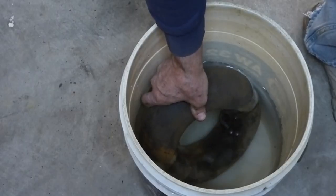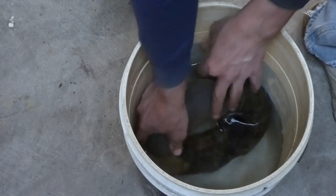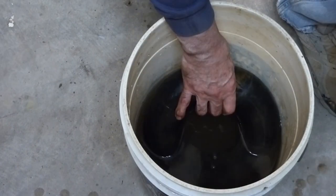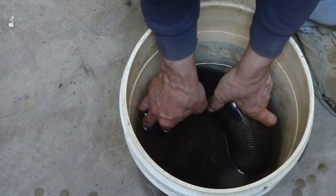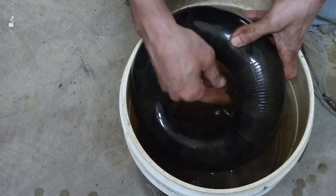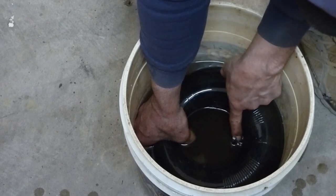Just looking for bubbles. There's one at the valve stem, and if that's the case you want to check that before you take it off the rim. They're coming from somewhere — oh boy, right at the base of the valve stem, it's leaking right around here. That's not good. There it is — right where the metal and rubber are connected.